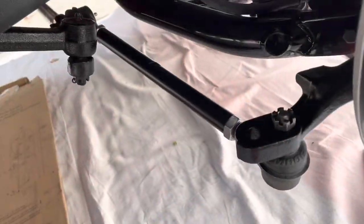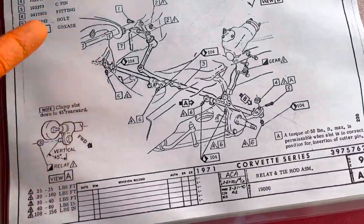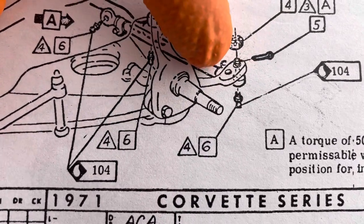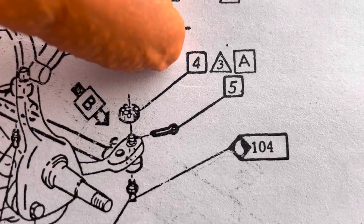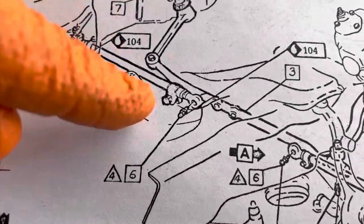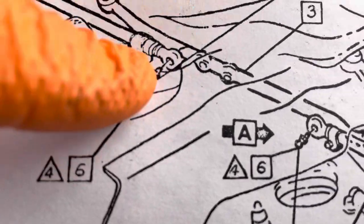I have these in place, and I was looking at torque. I found page UPC 9 referenced in another page I missed earlier — it does have torque specs. On my car, which is a manual, you can see it shows the farther back position. But I'm putting it in the forward position. Torque spec references number three, which is 30 to 40 foot-pounds. And for the inside, it says number four, which is 40 to 60.